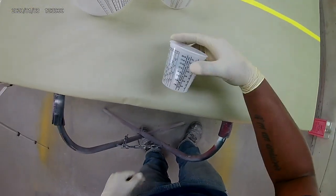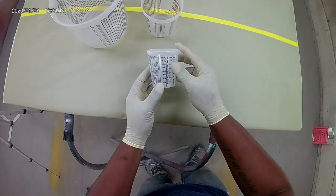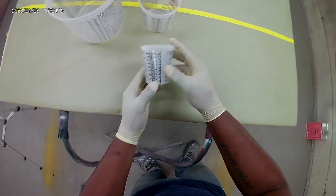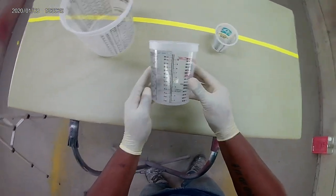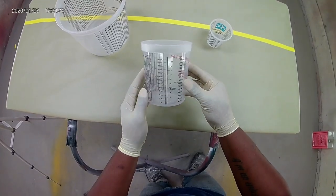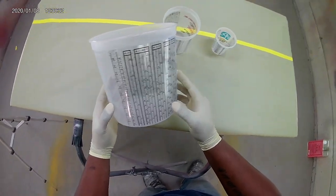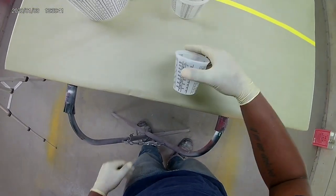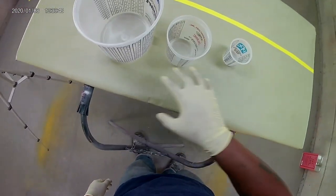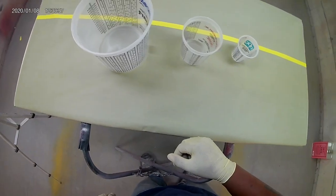The pint cup I use if I'm doing small blends that don't require me to mix up a lot of paint. Then quart cups — I use those if you're doing larger panel blend jobs or painting panels to mix up. Then I use the five quart if I'm doing an overall paint job. Because you want to be able to save your time and save your money. You can use them all either together or separate to save you time and money, because you don't want to be mixing up a lot of material if you don't have to.